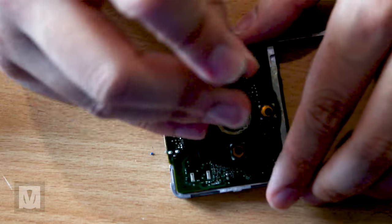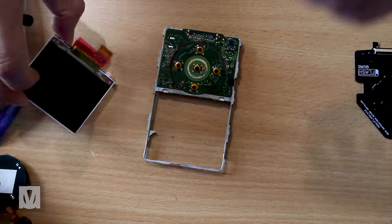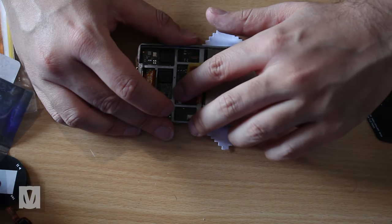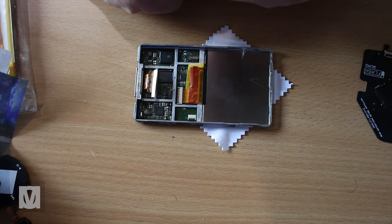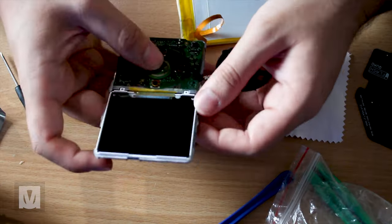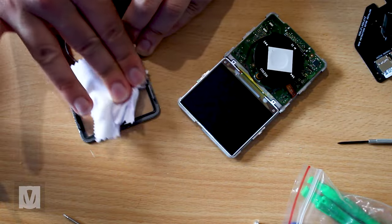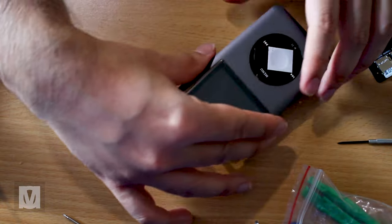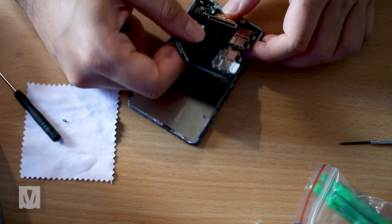Time to unpack and install the main board to the chassis. The board looked clean and brand new. I put down a microfiber cloth to protect the screen. Note: first attach the click wheel before you screw down the board — I forgot to do that and wasted a bit of time. I attached the battery next to ensure the board booted, then cleaned the screen with a microfiber cloth and attached the face plate. I attached the iFlash quad next with the SD card already inserted.